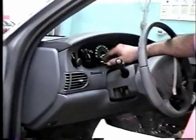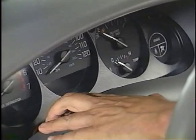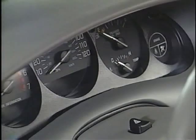On early cars, an itching noise would sometimes be heard at the instrument panel. The noise is produced by the IP rubbing against the gauge cluster. To prevent this noise, all you need to do is put some foam tape behind the IP to prevent it from rubbing on the cluster.